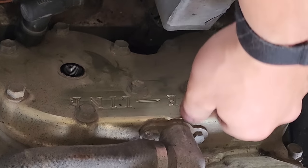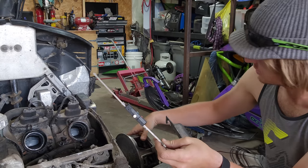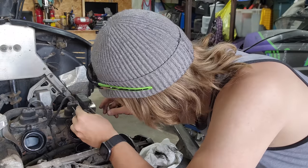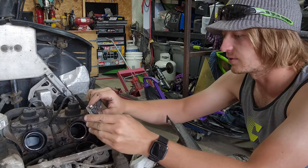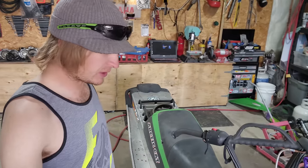This is that RK Tech head — this head can go either way, it could be a 700 or an 800 head. I can measure it through the exhaust port but I keep getting mixed results doing that. No, that's not even going to work — the way those exhaust ports and the transfer ports are lined up, I'm not going to be able to get an accurate measurement this way. Off with its head — big can for big jobs.